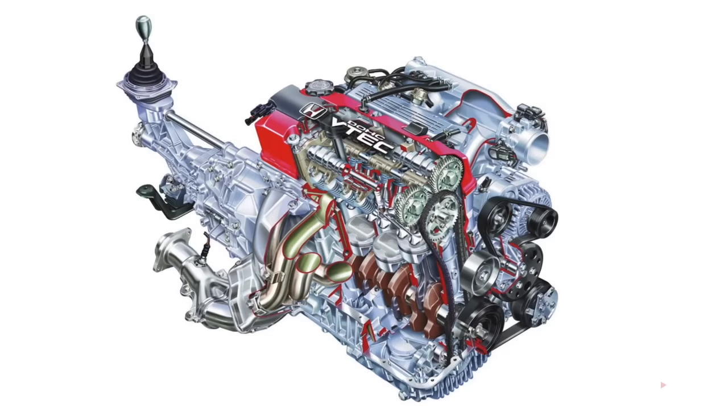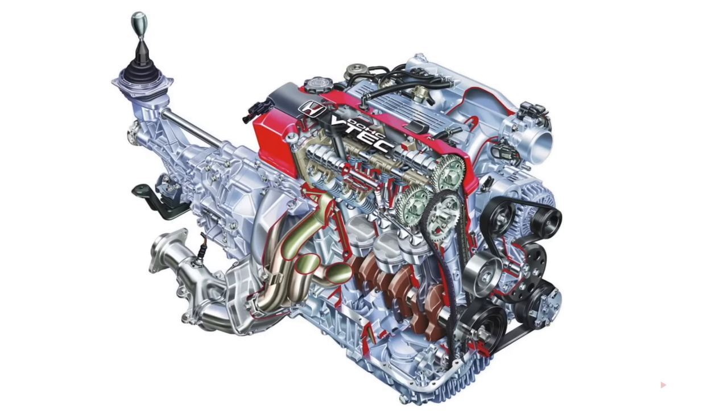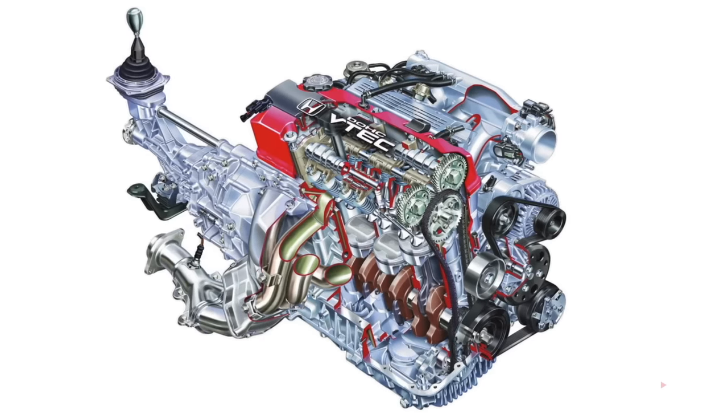So there are cases where you'd have an undesirable stroke for the RPM or the power band. Well, the Honda engine's no different than any other piston engine. And if you look at what Honda did with the F20C, which is arguably one of the highest output engines per cubic inch that Honda ever built, you're dealing with a long connecting rod, a relatively short stroke, and a bore that is big enough to fit the valve area that you need to make the horsepower. So a lot of the bore stuff is determined by valve area, but that's a whole different sidebar conversation. And right now we're just discussing stroke.